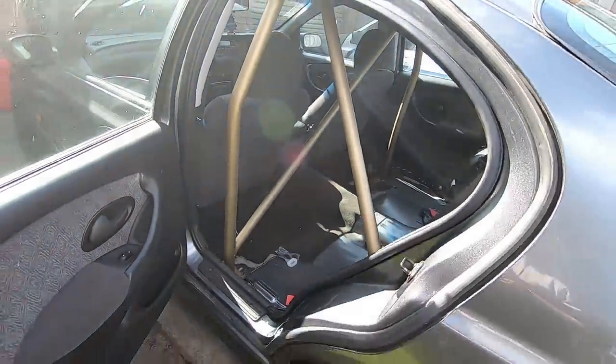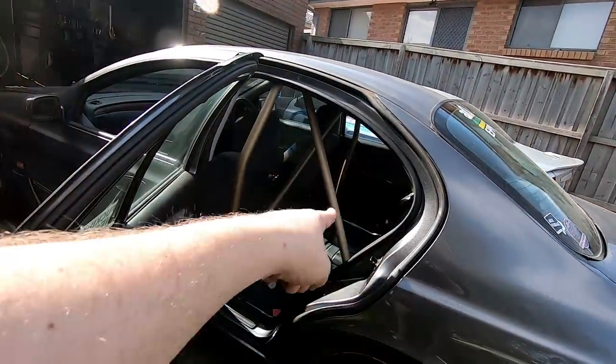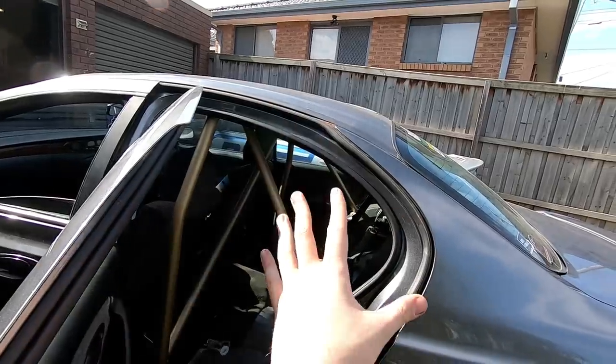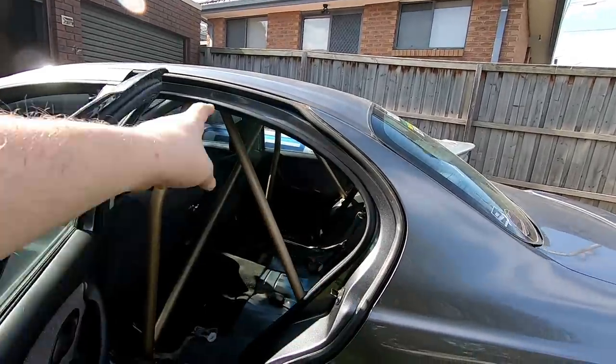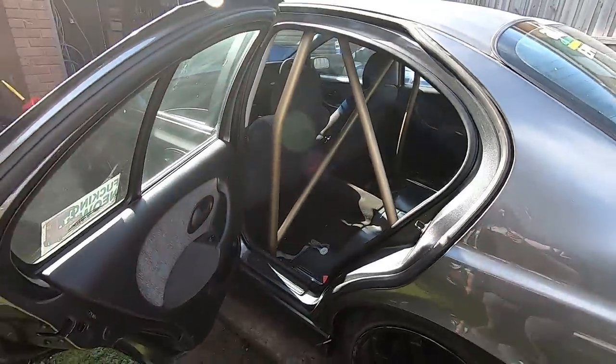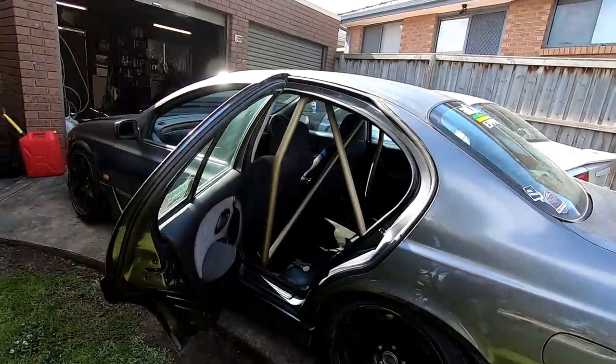It was a bit of a pain in the ass to fit because the other car had an accident. This side of the cage was kinked so I had to cut the top off and weld the bar a bit more on an angle. This side fit up alright — it was a bit wedged but we managed to make it work. So it's all welded up now and painted. I'm probably going to do some clear coat over it so I'll just drop sheet the interior and clear coat that.